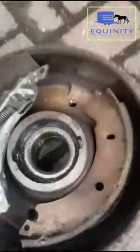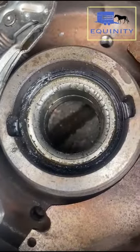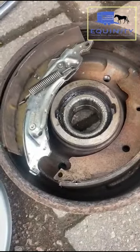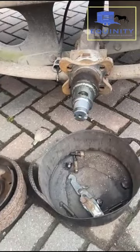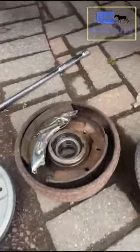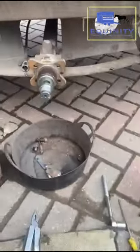These particular trailers have a sealed bearing, so this bearing you would need to check for play. Once we've got the hubs back on the trailer, we tighten the nut up and then check for play with the wheel attached. If there's any play, we would consider changing the bearings. That's quite important because the hub itself and the brakes will get damaged if there's any play in the hub. So it's really important to make sure they get checked.